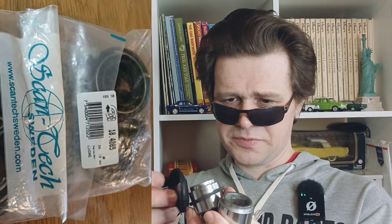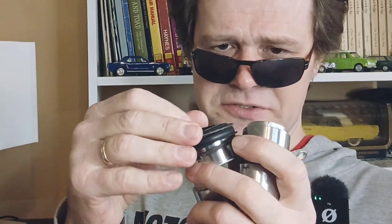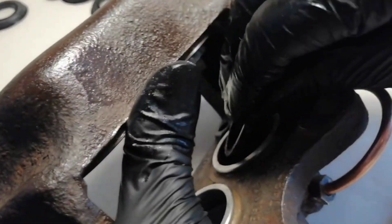This is really old, and you'll want to buy a repair kit and replace the components. That's what I'm going to show you today. This is just a dust cover — it protects from penetration of dirt, mud, and salty water inside. Here is the retainer ring. During the rebuilding process you'll want to replace the pistons, these rings, and the dust covers. And if the brake hoses are swollen inside, you'll probably also replace the brake fluid, because different fluid types can cause hose swelling.